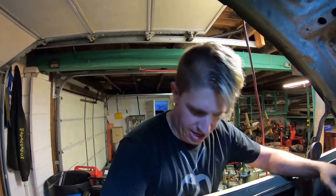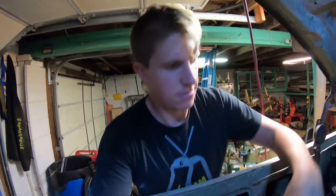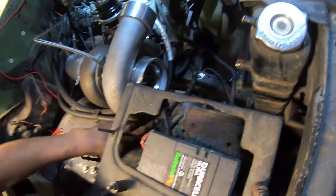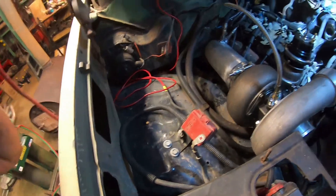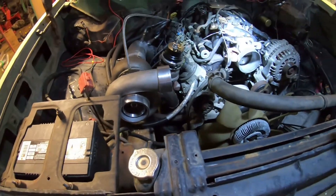We've got a little update here. I've been chipping away at things, getting as much as I can put into place and sorted out. The whole front is back on and assembled. I've got the battery in place. Had to do a little wire rerouting, but I think I've got everything where the wires will be safe. I can access what I need to access — I've got my junction block here, I'll shorten this wire up once I'm sure of how I'm going to route it. I've got my heater hoses put in — those actually clear really nicely. We'll see if it's too close to the crossover pipe down here, but being that coolant is going to be running through it, I think it'll be okay.